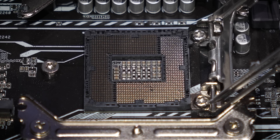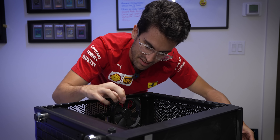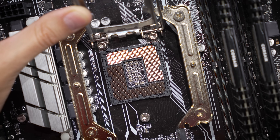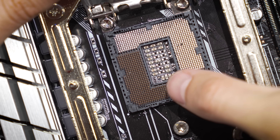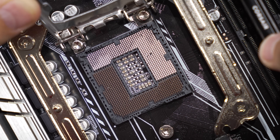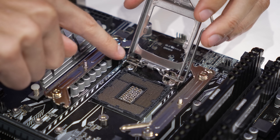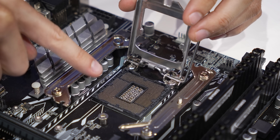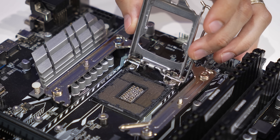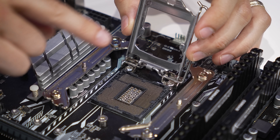Oh yeah — we've got socket damage. Let me go ahead and remove the graphics card. We'll get this motherboard out so I can show you a bit better what we're working with, and it'll also make it easier for me to try to bend these pins back into position. Here is what we're working with: we've got one up here to the top right, one a little further down, and one off to the bottom left. A few others might pop up while I'm looking longer, but this was definitely in bad shape, and I don't blame the system for not wanting to post. The owner tried removing the entire socket cover assembly and screws to install the CPU cooler — which he didn't have to do — and I think during this process he may have stabbed a couple of pins with a screwdriver. We're going to have to try to fix this if we want to save the board; otherwise I'll have to buy a replacement on eBay.